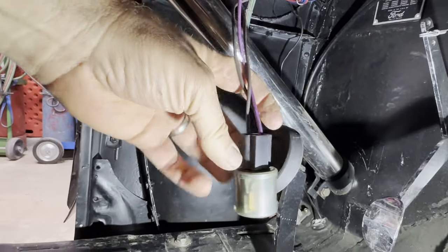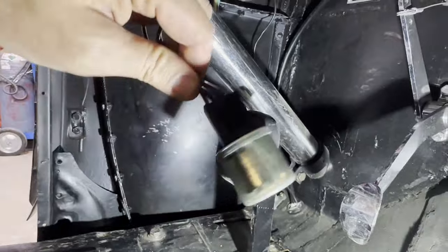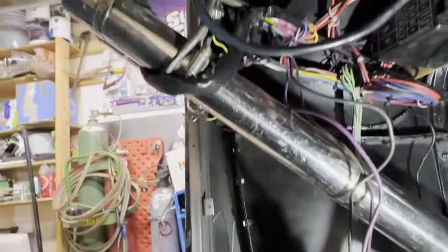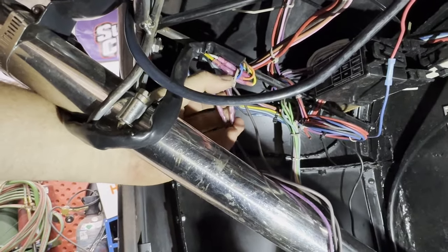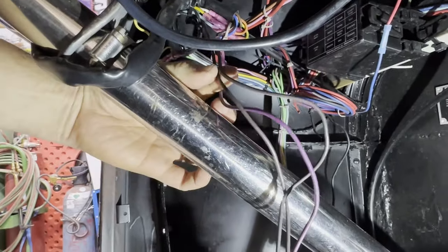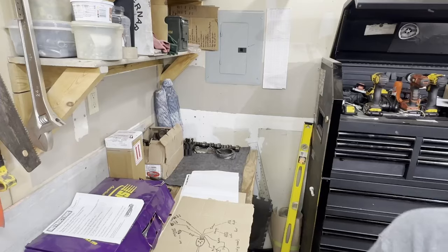Let's go climb into the car — I'll show you how this ties into the wire harness and give you some proof of how this thing works. Here's how it's set up in the car. This is a headlight plug that was just hanging out in the wire harness — it only had two wires pinned in it for one of the two-way flashers. I just repurposed it and put my third wire in there to make this three-plug flasher work. Here's my column and my switch — the wires come around underneath and right up here you can see my blue wire and my black wire tied in, and coming out of the wire harness of the car is this brown wire labeled 'hazards' — that is a constant hot from the hazards circuit. I just rolled this wire up and tucked it underneath the dash, and it works like a champ.